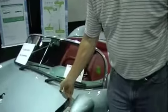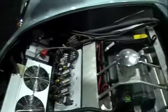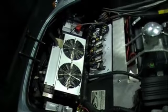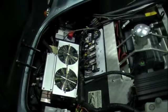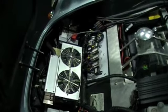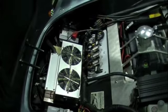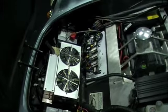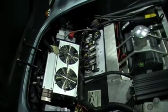The front of this car — you can see the item that looks like a hot plate there, with two hot plates. People ask if I cook breakfast on it, but that's the inverter for this one. As you can see, it's quite a bit larger than the one on the maroon car. This inverter is capable of processing about 320 volts, so it actually has more volts, a little less current, but it generates a little more heat, so it's cooled a little more substantially.